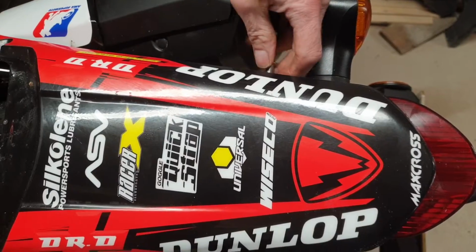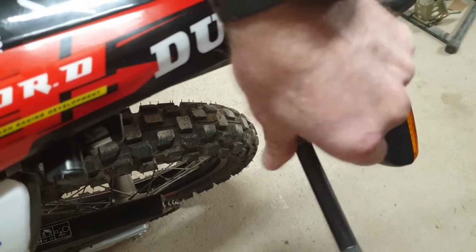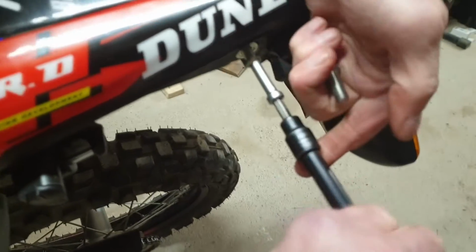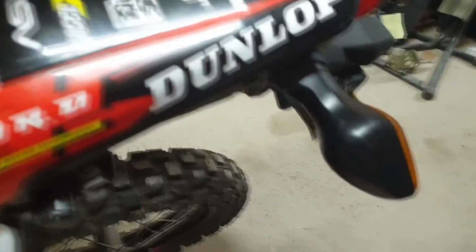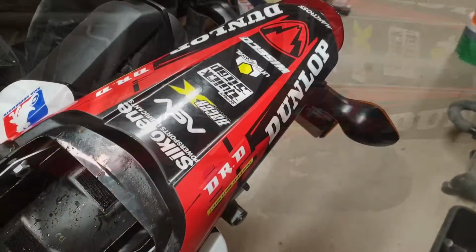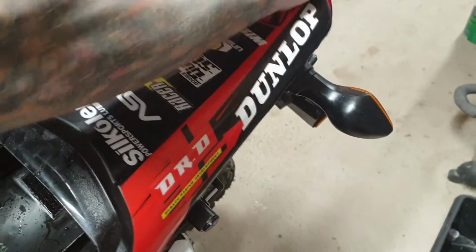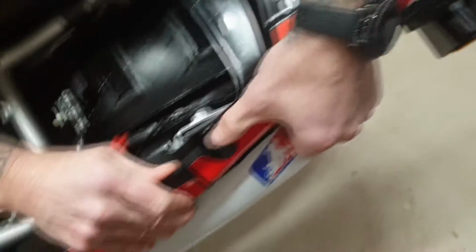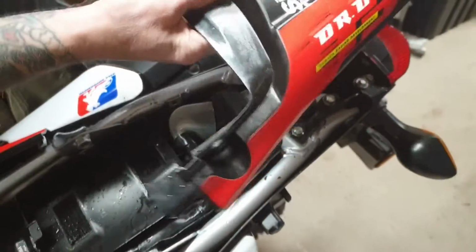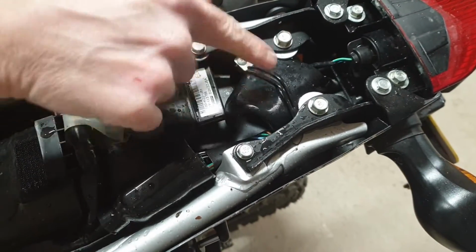Okay, now remove the rear two bolts. There's little top hat spacers here. Don't drop them, don't lose them. I'm going to need them. There's also a couple on the first two that you've taken out. They do tend to stay in there, so don't forget those. Sometimes they can stick in. Right, okay, that's the first four bolts out. And what you can do, you can just ease these out now. They're just held in position by these little clips, there you go, and that just pops off. That exposes all the wires, and everything we want is inside there.